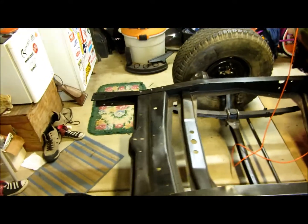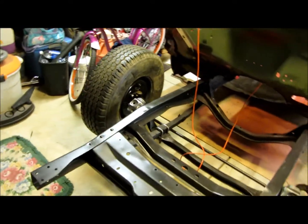Having found that, I'm kicking around the idea of maybe getting a cam to put in it — a little Isky cam or something, Iskenderian. I gotta tell you, the rear main seal leaks, oil pan leaks, I gotta take that apart, and valve cover gaskets are leaking, so I need to fix those. I think I might get a different cam for it and put it in there — it's a little easier to change on the stand than in the truck. At the very least I'll do it before I put the front end back on — radiator support and all that, it's a lot easier without that stuff on there.